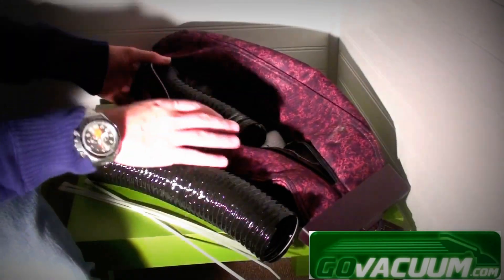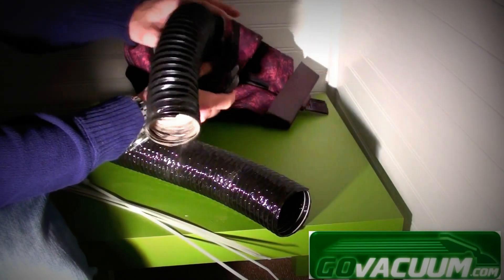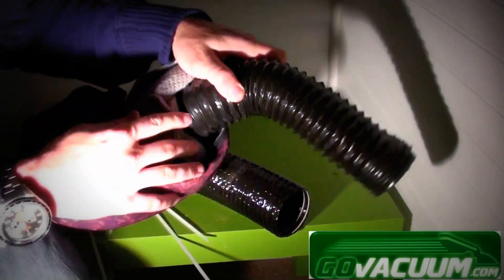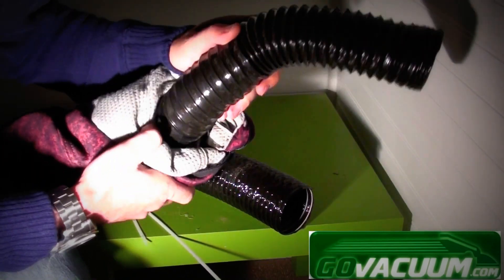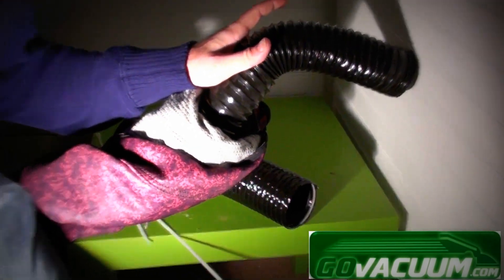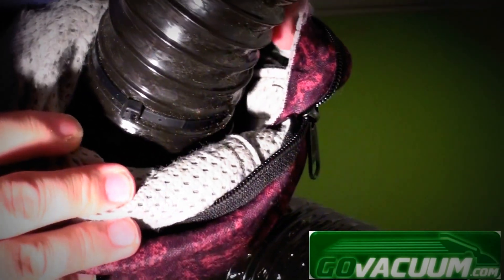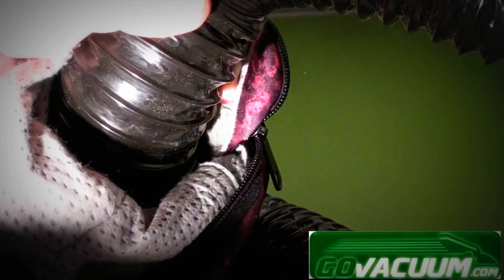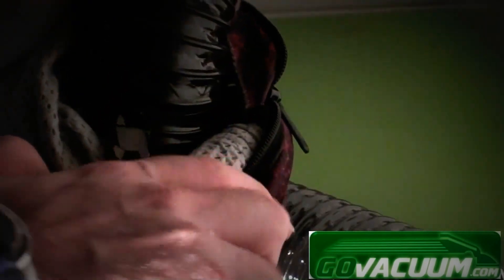The difficult and challenging part is the other end of the fill tube that connects to the boot of the vacuum cleaner — it's hard to reach and hard to get to. You can see at the bottom of the bag is where it connects, and usually there's tape around there as well, so go ahead and cut that tape. You also have two ties you'll need to cut off. Let's zoom in — you can see there are two ties that we need to cut. The easiest way is to take a pair of wire dykes and cut the old fill tube bag ties off.